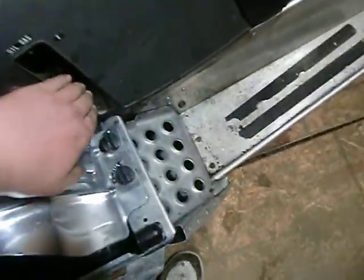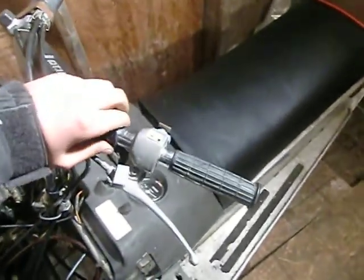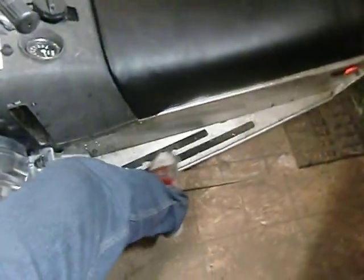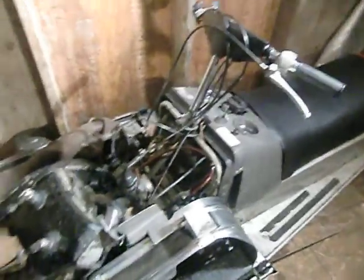I mounted the front bumper. The gas tank had a leak in it so I had to fix it — there was a fitting supposed to go through for a line, but I just put a bolt through it and sealed the gas tank around it, and that worked. I still have to take the suspension out and fix it up — it needs new sliders, new absorbers, and possibly new front springs. I'm gonna clean it up and repaint everything in there too. As for repainting the rest, other than the skis, shrouds, and muffler, I really don't think it's gonna need much. It's all aluminum, much easier than the 292.